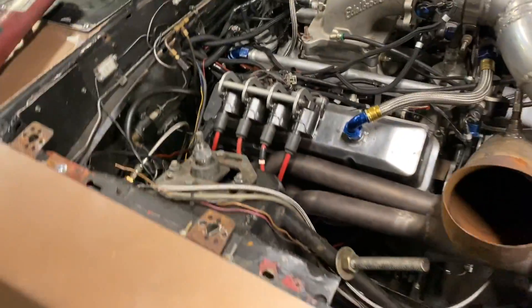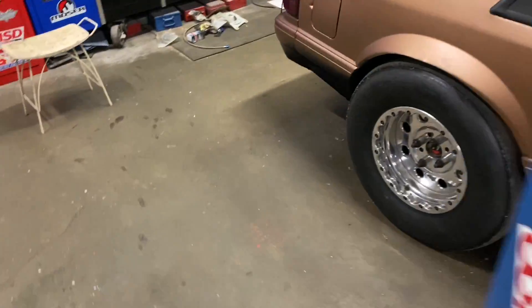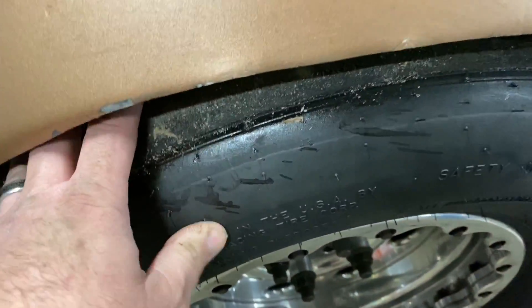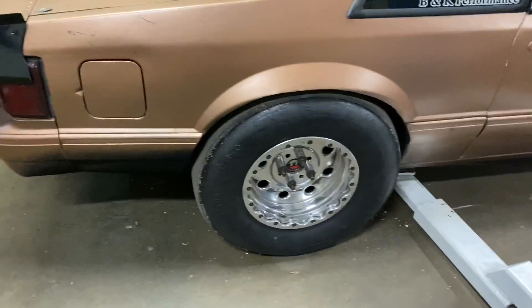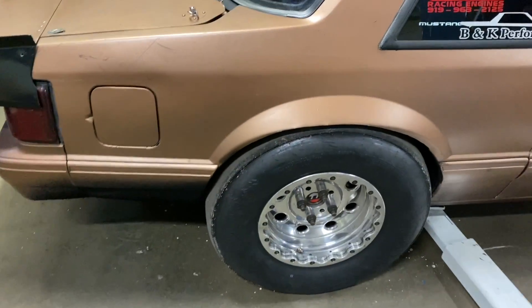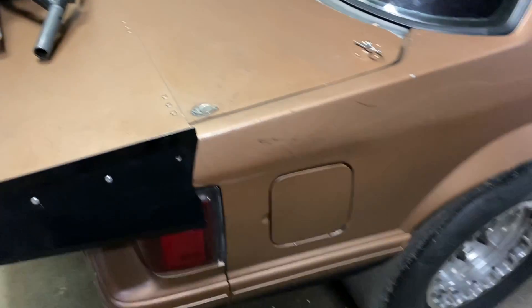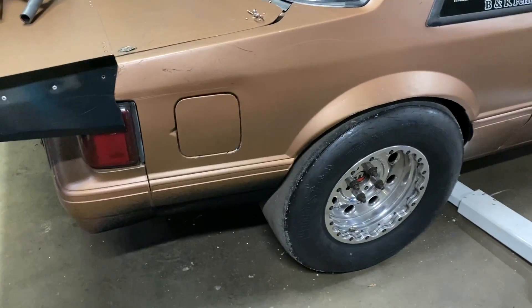That way I can have about an inch of travel and not affect the front ride height — I need that to happen. That's all I'm doing up front. The other thing I've got to do is back here in the back. This thing still has these Hoosiers on it, and I'm going to try to make this tire behave more like a slick. You can see in the video I released a couple days ago from the Road Rage race — it's still squashing the tire pretty hard.